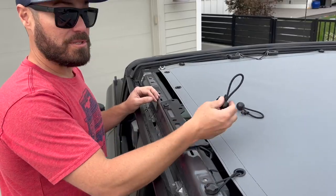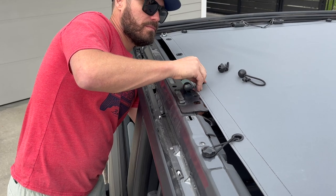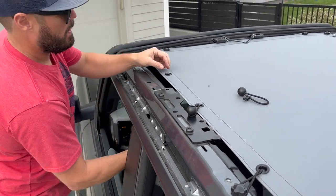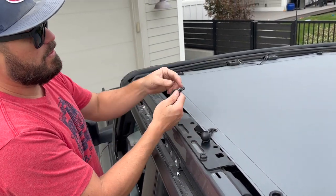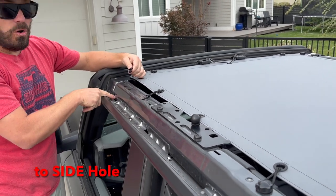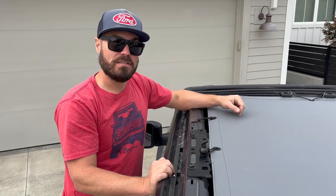On the opposite side, take the bungee through the rear oval hole, down through, up to the grommet. This is going to be a tight stretch now — we're starting to get a lot of tension here, backing around. Take the short bungee with the clip, up through the hole, into the hole on top. And again — here's the important one: up through the bottom, stretch this all the way around to the hole on the side, not the top. Now let's make sure we have all our finger bolts tight. That concludes the installation of the Bronco Bimini.